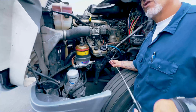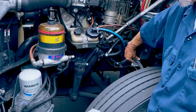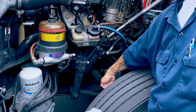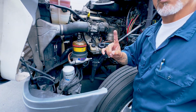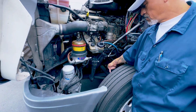I move on to my service brakes. Brake hose, no cracks and no leaks of air, bolted tight and secure. My brake shoes are inside here. You can't see them, just use your hands to point. My brake shoes and brake pads are inside here, no less than a quarter liner left. My brake drum is also in here. No oil, no grease or discoloration.